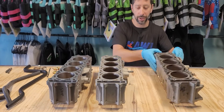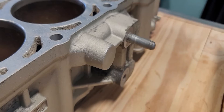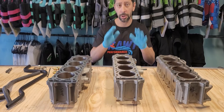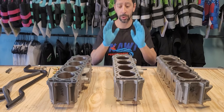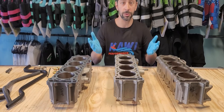they actually went with really shallow cooling jackets, which only go down to here, and there's actually no water port on the side. But the problem with the 300 that they realized is during the hot months — July, August — or wherever you're located, when temperatures were really hot, you would lose speed because the cylinder would heat soak and there's not enough water in here to keep the cylinder cooled enough during those months.